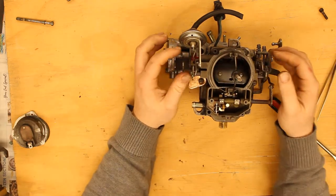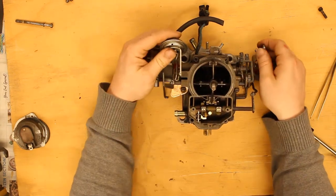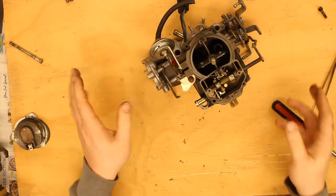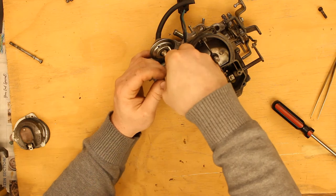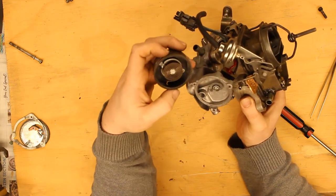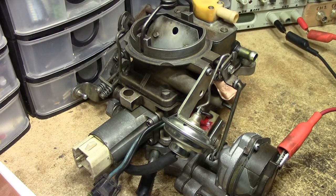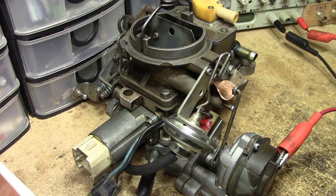As you can see, I did lightly clean my choke plate — it's also lightly oiled on either end and moves just beautifully. The electric choke on the side here — I've seen people completely disable it to put in a manual choke. Really, you shouldn't have to. The electric choke is simply a coil of bimetallic material. Apply 12-volt voltage across it and it uncurls itself when it heats up. It will slowly allow the choke to open up on its own before finally the choke unloader holds it open completely, and it'll stay like that until the engine cools off. You don't have to mess with the choke — it's really nice.